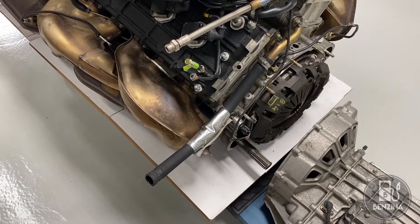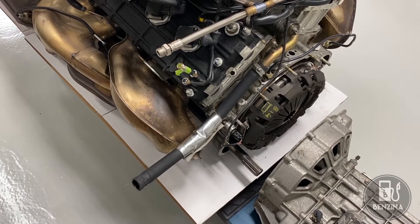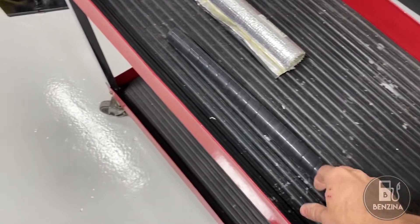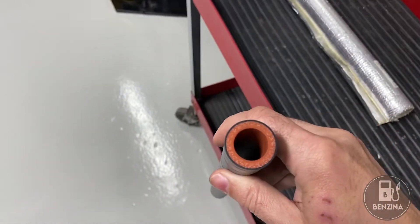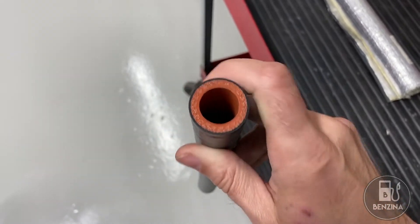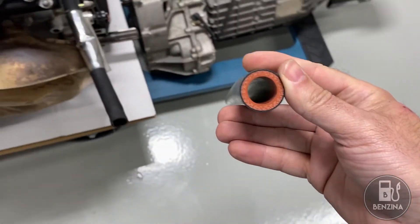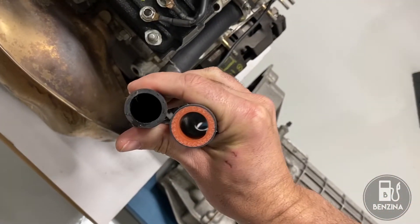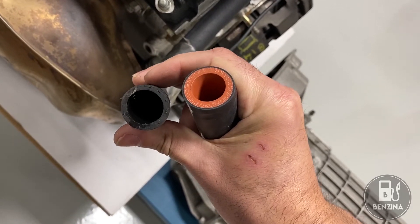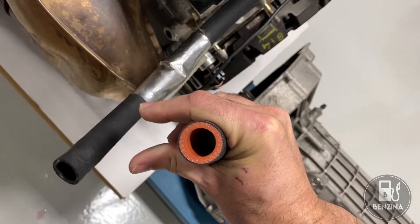In my particular case, I decided to take it a step further and install a hose significantly stronger than the one offered by the factory. These are the two items I'm going to be installing. The first is this piece of hose — a four-layer silicone hose, high pressure, high temperature. I bought it from siliconehose.com and it's a three-quarter inch internal diameter. The factory hose is 19 millimeter, which is effectively three-quarters of an inch. If you compare the two hoses, you can see a significant difference in thickness. Whereas the factory hose has one layer of braided reinforcement, this one has four layers of braided reinforcement, and the materials are stronger to start with.